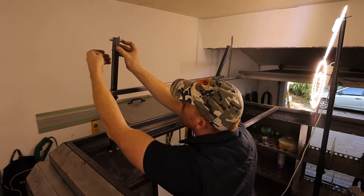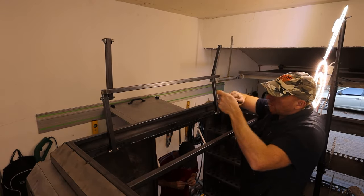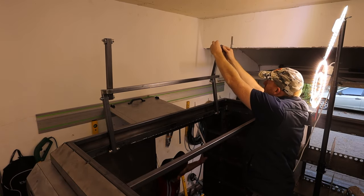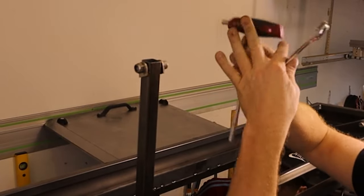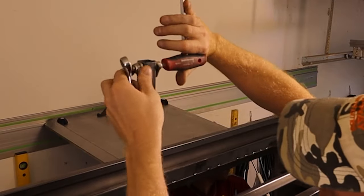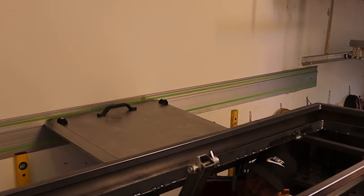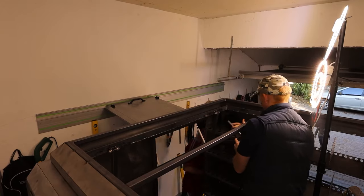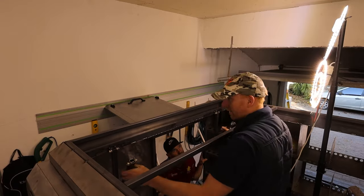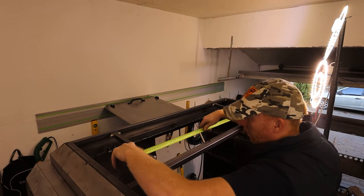I ordered them and what a total mess it turned out. With one on each corner you could practically hang on the roof in its open position and not get the shocks to cave in and compress. I weigh 90 kilos and could not get the roof to move one inch. The shop told me they can increase the pressure of the shocks after buying them by sending them back to the manufacturers in increments of 50 newtons, but they cannot lower the pressure — you can go up but not down in force. That left me with four shocks to use as nice paperweights.